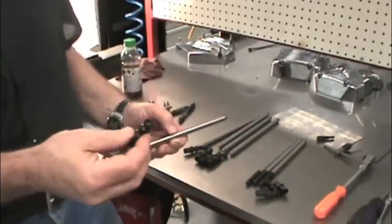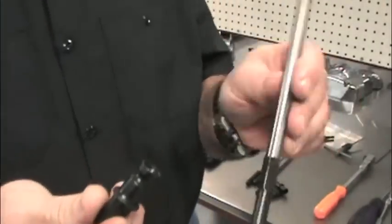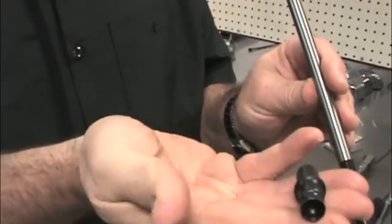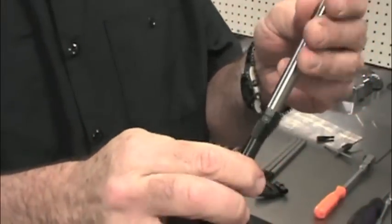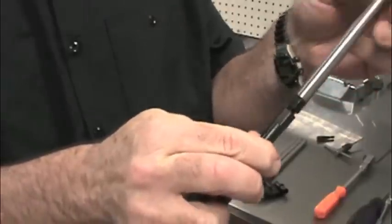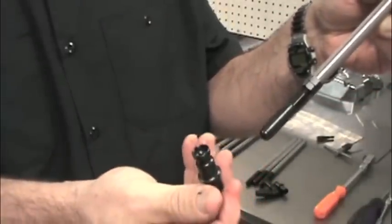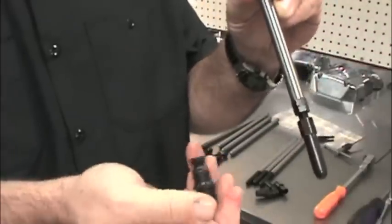Finally, we have the S&S adjustable pushrod kit with solid tappet adapters. These adapters also replace a hydraulic unit to make a solid non-adjustable tappet. With this kit, the adjustment is in the pushrod. This kit can't be used with panheads unless you use shovel pushrod covers. Otherwise, you won't be able to get a wrench on the adjuster nuts.